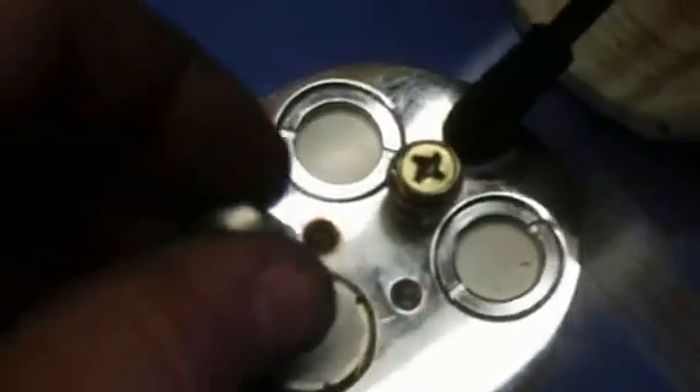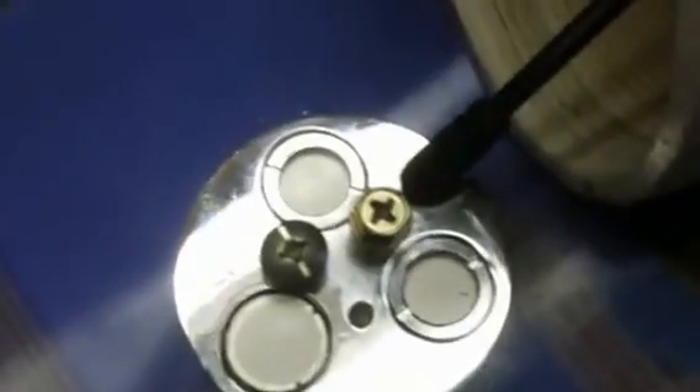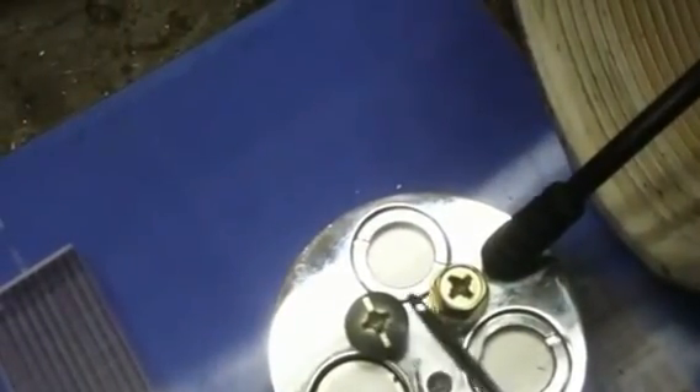What I did is I tapped out the holes and put Teflon around the screw to make sure no gasoline can get down there. This one is the one that actually is pushing a wire to ground to make continuity between the case. And that's where the sensor used to come up across here.